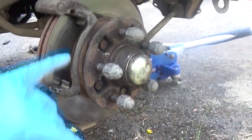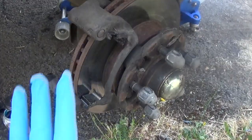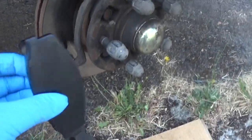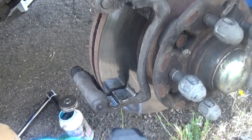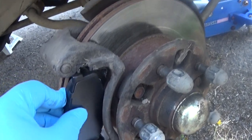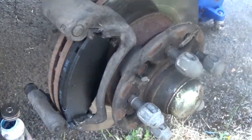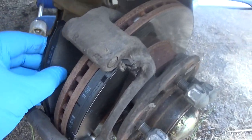Now that I got all my clips cleaned up and lightly lubed, I take my new brake pad and put the shims to that side — it'll pretty much only go in one way. You just slide this groove down into that groove right there, and there's one like that on the top as well. On this front one you have to kind of clear that bar, but on the back one it's the same way and a little easier. Next I'm going to make sure my piston's all the way in, then clean up and lightly lube the pins.